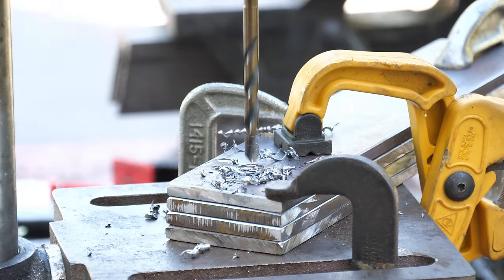That looks pretty good. And after seeing those in place, it occurred to me that, well, what if we just ran the parking brake cable underneath the exhaust? It's not rubbing on the drive shaft, which is a bigger concern, and these are just uncoated stainless steel cables, so they shouldn't have a problem with the heat. I am a little worried that this clamp is going to bounce around and make a lot of really annoying noise, but for the time being, it's good enough, and I really just have to move on.